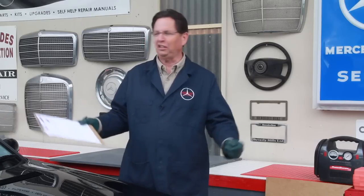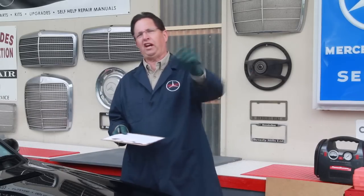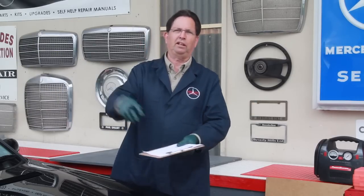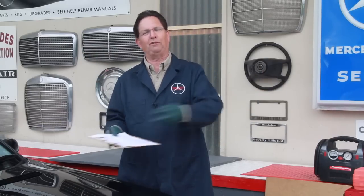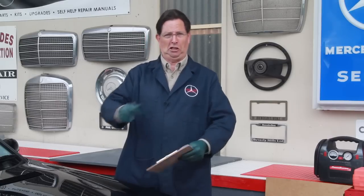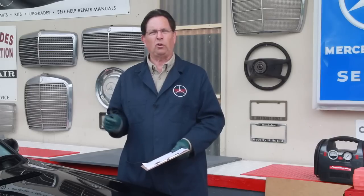I see some of these YouTube videos where guys are doing oil changes and filter changes on their car, and their engine is absolutely filthy. And they're whipping the air cleaner out and shaking the air cleaner box and throwing the new air cleaner on and slapping it back on, and they're pulling their oil filter out of a dirty housing, wiping it off and shoving another oil filter in and screwing it back. Oh no, we're ready to go. Well, can you imagine how much damage that just did to the engine? Injecting dirt into the intake manifold, or adding a little bit of grit into the engine oil?